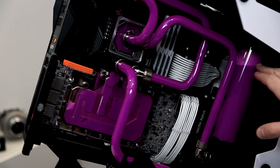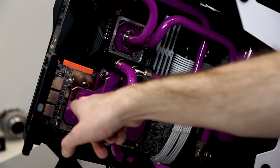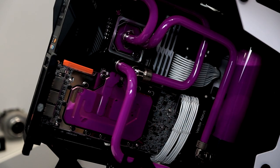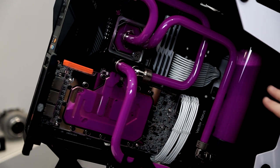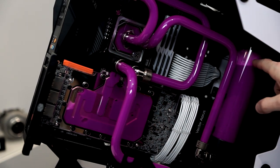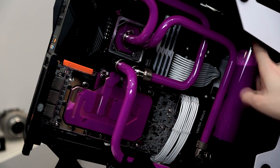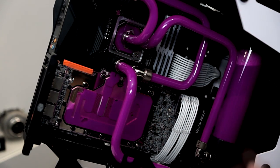The coolant level is going to drop a little bit — I've seen people flip out when they see it drop and think they've got a leak. There is still quite a lot of air in the system; you can see it in the graphics card and there's a little pocket at the top of the CPU water block as well. There's still a lot of air inside the radiators that will work its way out over the course of the next week. As that air comes out, it'll be replaced by coolant. I've plugged up the top now; we'll release the cap periodically to let any pressure out, and I'll leave it for probably another hour before our first boot.